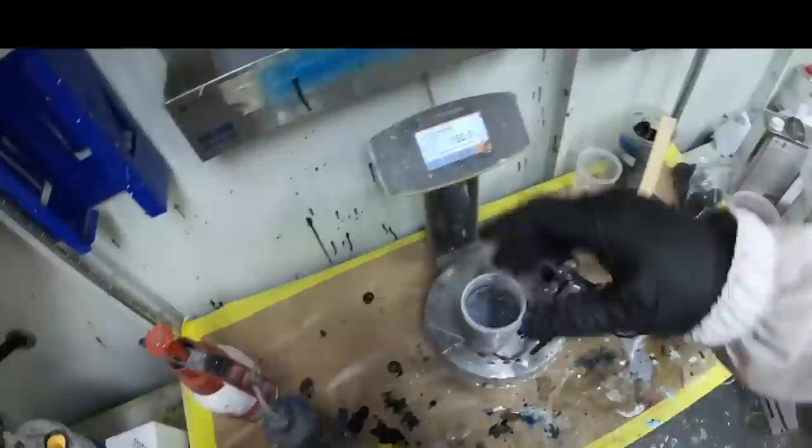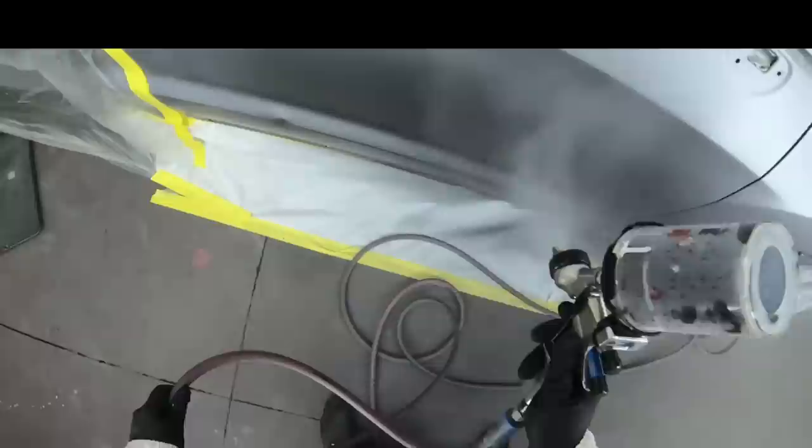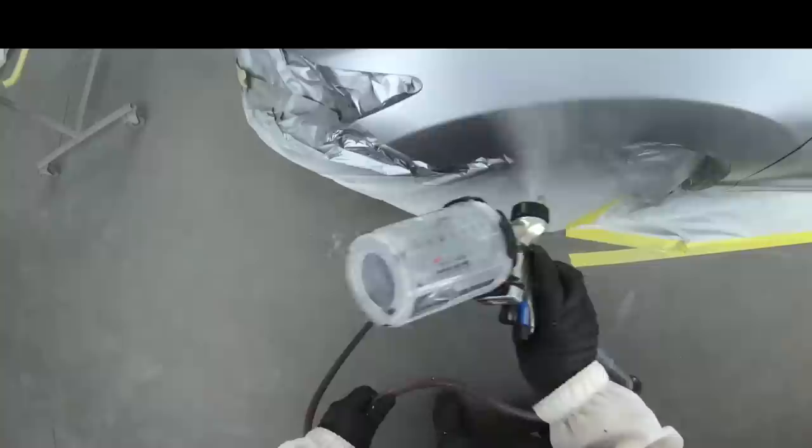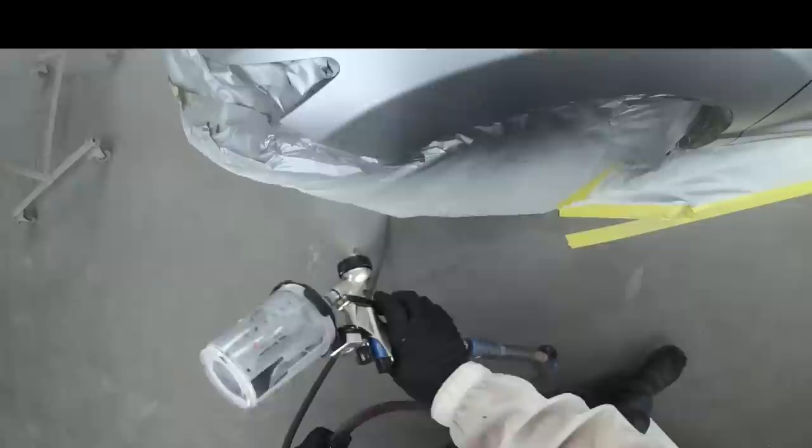So what have I done here? I've taken that color and I've cut it in half. I made it more transparent. I only got one coat really on both of these doors, and I'm just gonna add one more coat over reduced, and that's it. See you later. This thing is blended out. I don't even need to use the X pattern as much because it's so transparent. It's just going to hide your blend. Now you can do this over the whole hood if you want. I'm just doing it over the blend panels because I want to make sure that it looks even more transparent. I used to, in the past, use our blending additive on the doors. I don't do that as much.